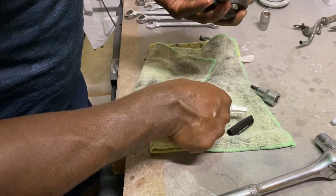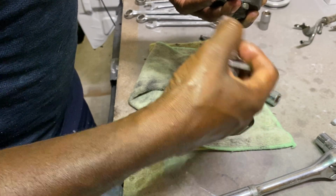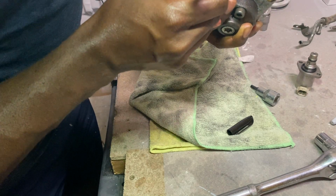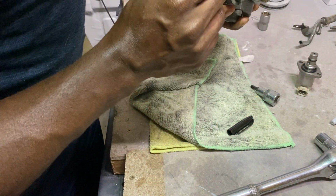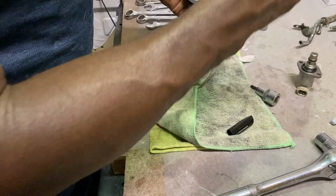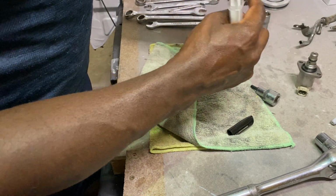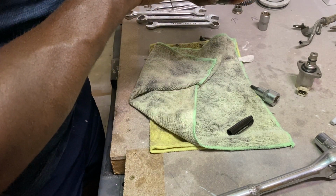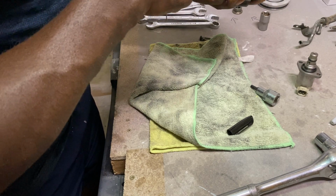And then this is where your suction control valve sits, and when it opens, it goes through there and comes out from here. And there's 3 holes there, 1, 2, 3. One goes into this pump, one goes into that pump. As the engine turns, those 2 little things go up and down and pressurize into these 2, and it comes out of that. So pressurized fuel comes out of that, and that's your return valve.